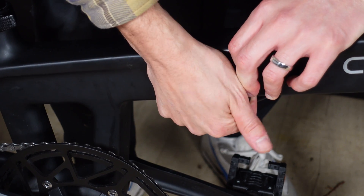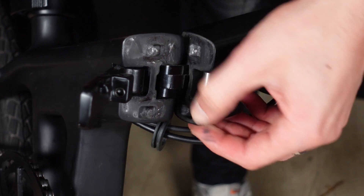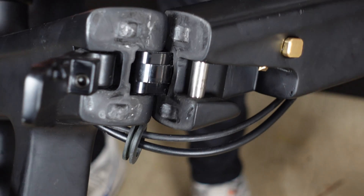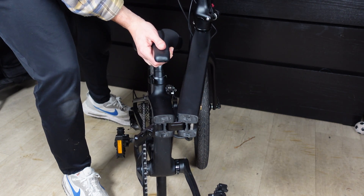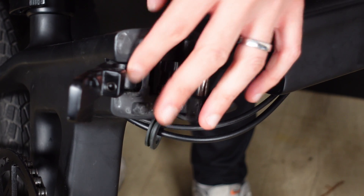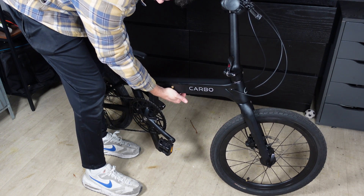The fold is the interesting part. I've never seen a carbon bike that folds in half before, and I was intrigued — I know how strong carbon can be and how fragile it can be. Carbon doesn't abrade well, so you don't want any rubbing or grinding at the joint. When the bike is expanded and locked in place it needs to be super tight with no play. The interfaces lock together really solid and you can tell they're solid carbon. One thing I like is the mechanism has a cushioned soft-close effect — you can swing it open or slam it and it will always be cushioned in both directions.